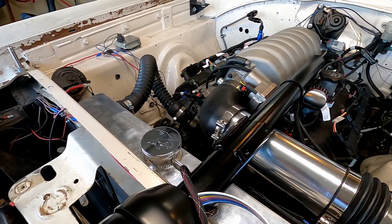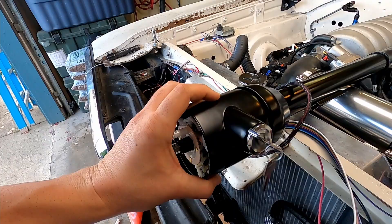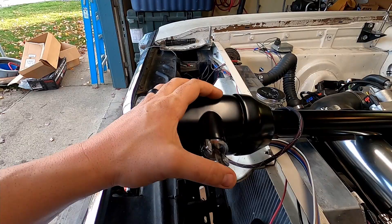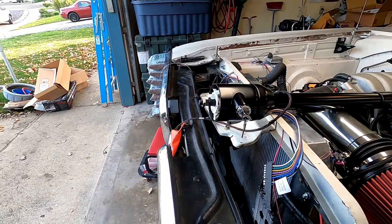So this is what they came up with — for 1970 B-body and I believe E-body Mopar. It's all powder coated black. The only thing I noticed is that it utilizes a GM-style key, so I've got a GM key in my Mopar, but it's not a huge deal. I'm sure at some point I could switch out the ignition for a Mopar-style one. Turn signal notch right here and the tilt steering notch right there.